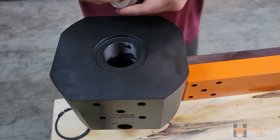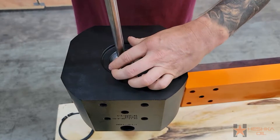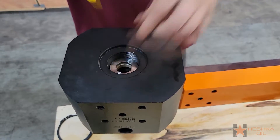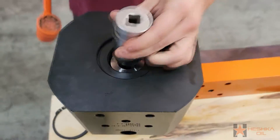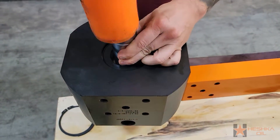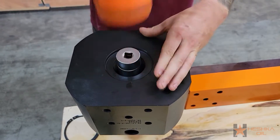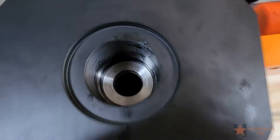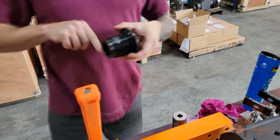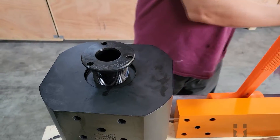The rest of the packing set can now be installed. After inserting the packing set, we use a deep socket about the same width as the packing set and lightly hammer down until the junk ring is past the threads. Once the packing is installed, apply a light layer of grease to the threads of the stuffing nut and rotate until it's flat with the body of the yoke.